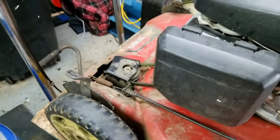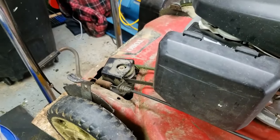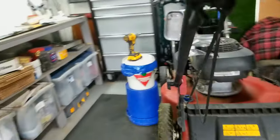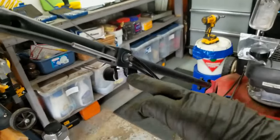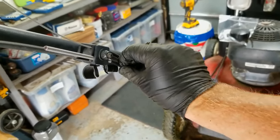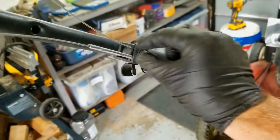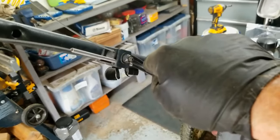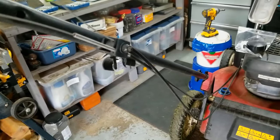I'd like to see it just a little bit tighter. To tighten this tension up a little bit, what you need to do is loosen this 7/16 nut and then pull the whole cable sheathing assembly — the holder — down a little bit so it provides a little bit more tension.